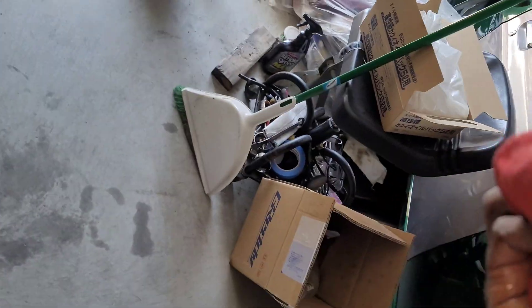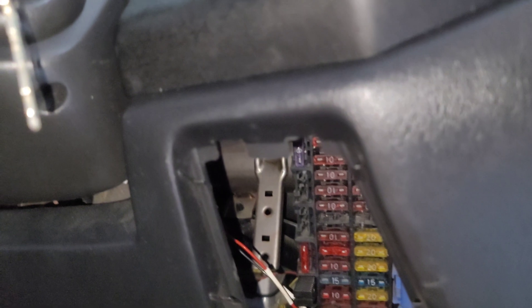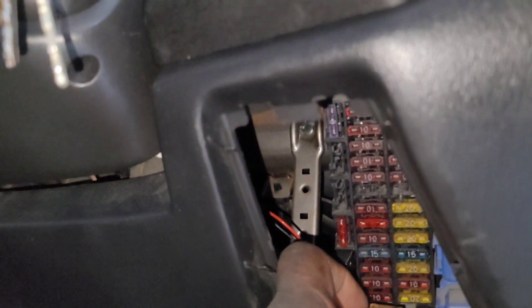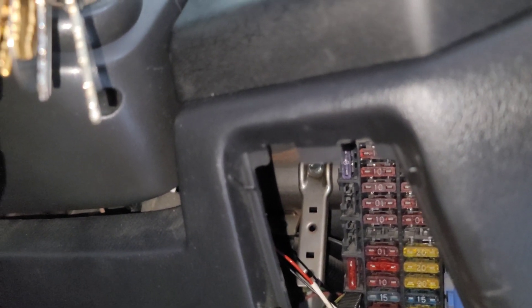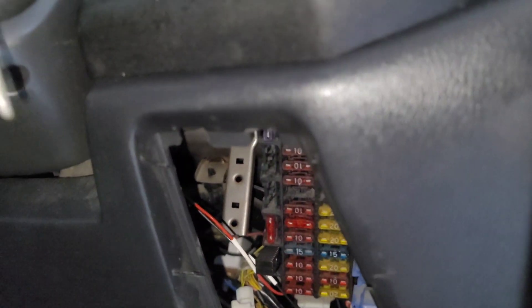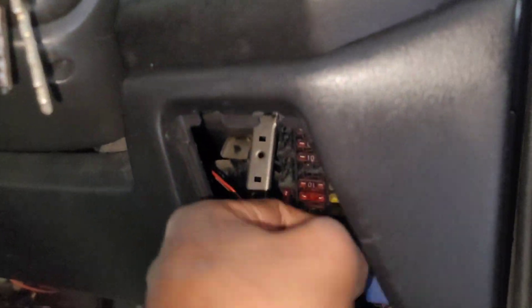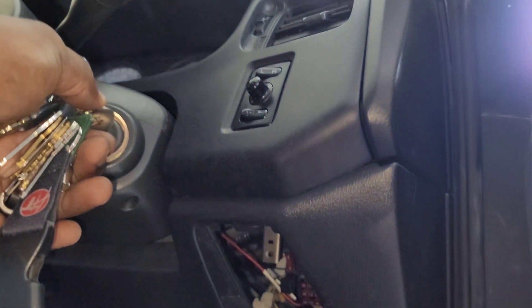Wipe your hands off - they're gonna be nice and dirty unless you've got gloves on. You don't want to put dirty hands in your car. Open the door and get your brown connector - see, the brown is just connected here on the R33. On R32s it's white. In the instructions it says disconnect and reconnect, but turning the ignition off and on does that power transfer for the connector. Connect the connector, turn your ignition off, then cycle it to the on position just to make sure you don't get anything crazy.